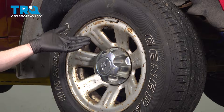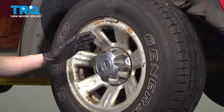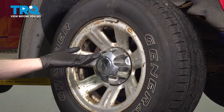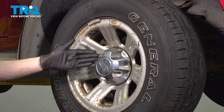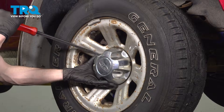Okay, friend, let's get started on our job. To gain access to the upstream O2 sensor, we're going to have to get behind the right front tire. Safely raise and support the vehicle so the wheel's off the ground. Once you've done so, carefully remove your center cover and then all five of your 19-millimeter lug nuts. After that, go ahead and remove the wheel.